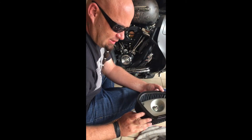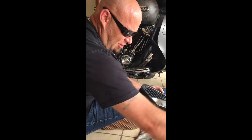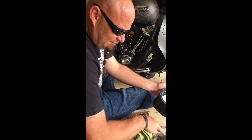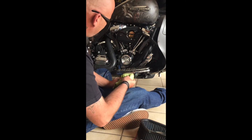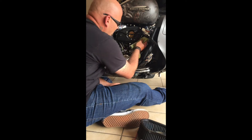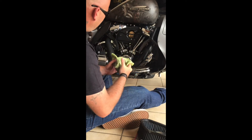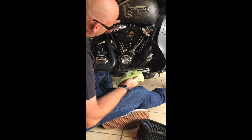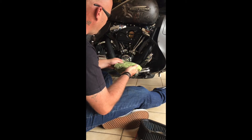The filter comes out like that. As you can see, here at the bottom I've got a lot of oil. The reason for that is these two pipes. What Harley Davidson decided — or had to do according to regulations — is that the oil that comes from your heads comes out through these two ports and goes back into your engine. So it's like reburning oil.